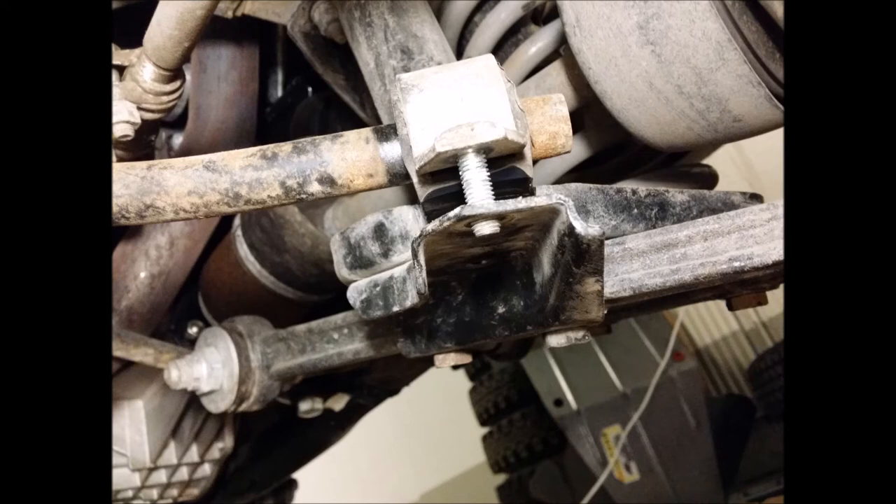Think about your strategy for reinstalling the sway bar and account for the time. Also, it is keyed left and right — the part that points toward the spring has a little hump on the back. If you didn't take pictures during disassembly, you'll be out of luck. A key hint: since the thickness of the plate that holds the spring on the A-arm is thicker than the A-arm itself it has a shorter depth, which will tip you off as to which side to reinstall it on. It is asymmetric.